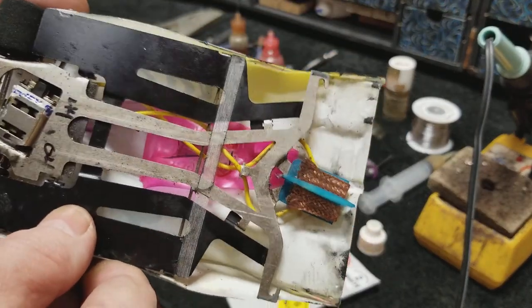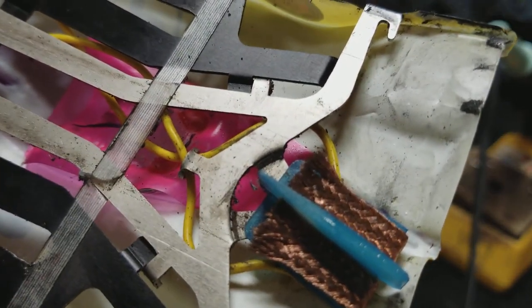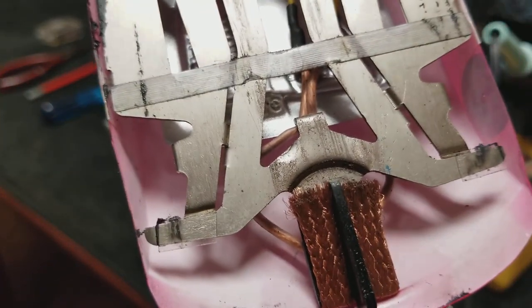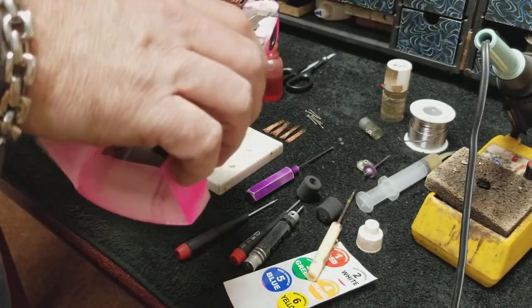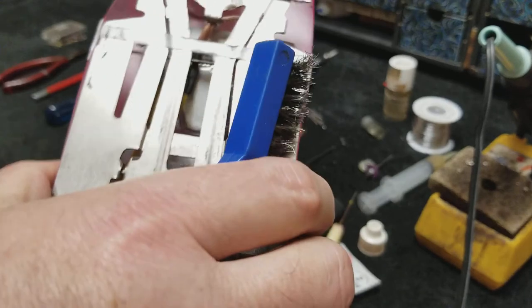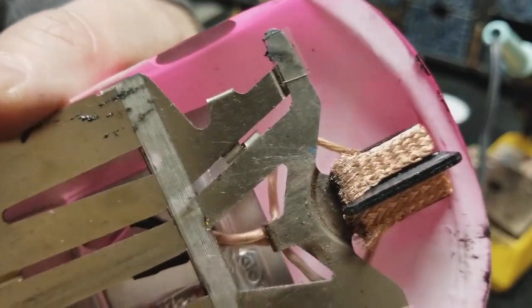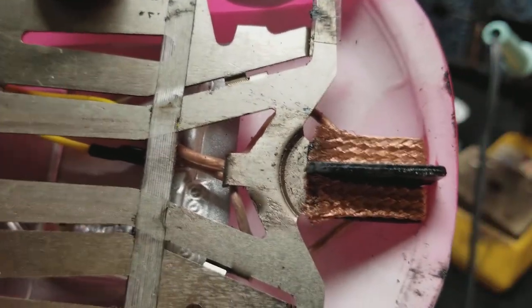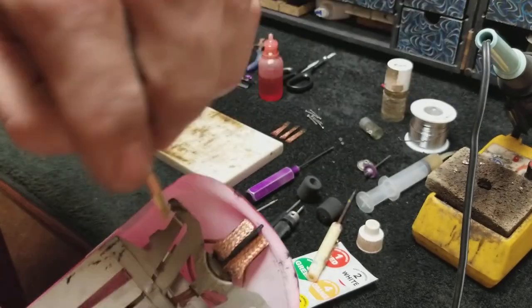Now this braid has a race on it — the tips are pretty nice and gold colored, so they don't need to be replaced. But this car was raced last weekend, and you can see the tips starting to get burnt. Usually you want to brush that out. If you can brush most of the burn out, you can just rejuice them and put them on. But if the braid is pretty well burnt at the tip, that braid needs to be replaced. Pull it out and put in new braid that you already have combed out and ready to go, and you're back on the track.